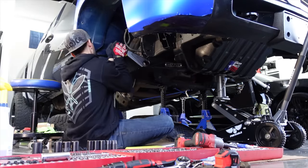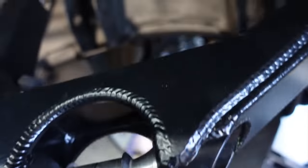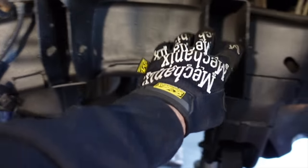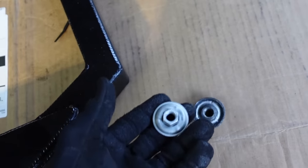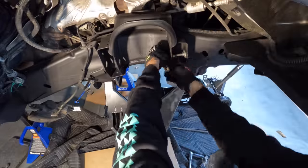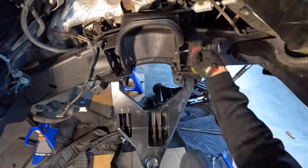I'm really impressed with this bolt-on kit. The only thing you really have to adjust or modify is the upper control arm mounting location. If you line one side up, the other side will be off just a fraction — like a quarter of an inch or even less. What you do is stretch it out a little bit so the upper control arm can fit in. We have a bolt and two nuts — we thread the nuts outward to spread the two mounting locations enough to fit the upper control arm, and once you cinch those down, it kind of reforms itself correctly.